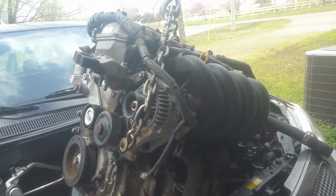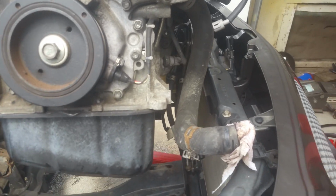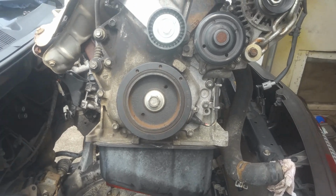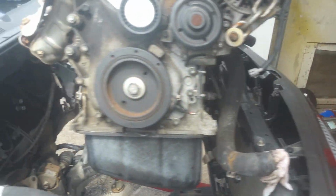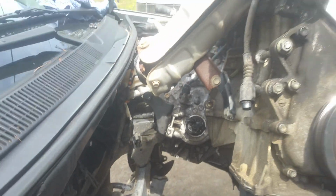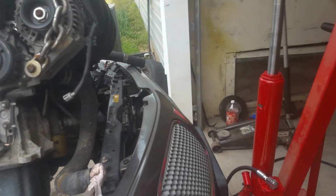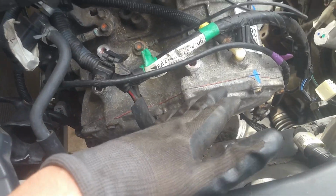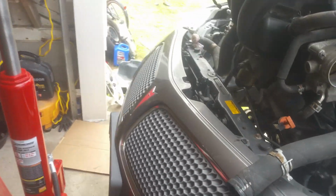Okay, so as you're working this down in here, as the boom lowers, it's going to go back more, so you just have to lower it a little bit, scoot your lift back some, and you can see I've got like an inch of clearance through there with that exhaust on there, plenty of room, and still got clearance up here, just going slow and watching stuff. Don't want to break anything. And I'm getting kind of close over on this side, so I'm going to have to push the lift and go that way towards the passenger side a little bit.